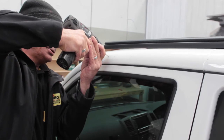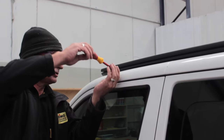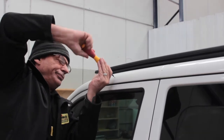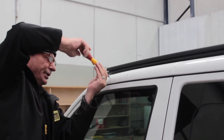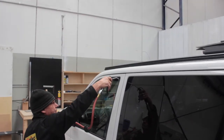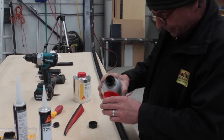Now I start drilling all the holes. You can get the self-tapping screws that are supplied in the spoiler kit, because these screws we don't use to screw the Multirail on. We use other screws which are supplied also in the kit. Just to get rid of any excess metal. First thing, we get some primer, because we've got to protect the holes we've just drilled, stop any rust.